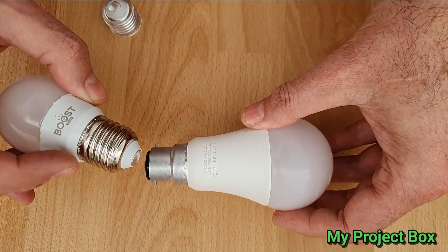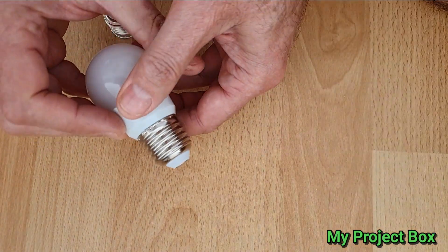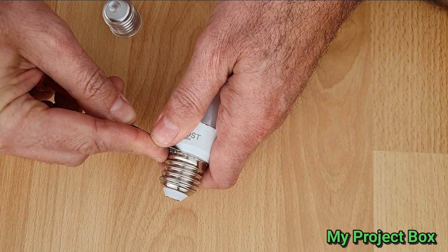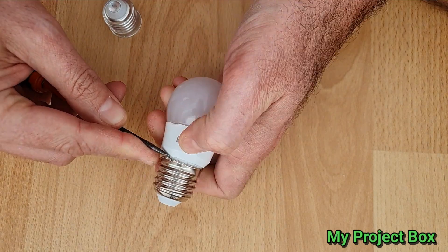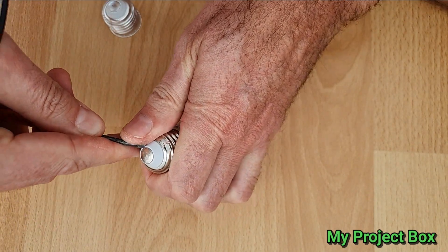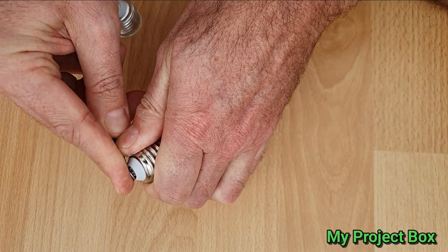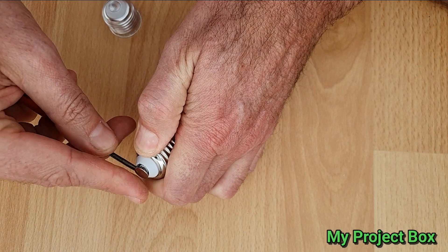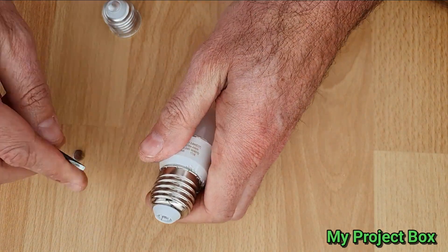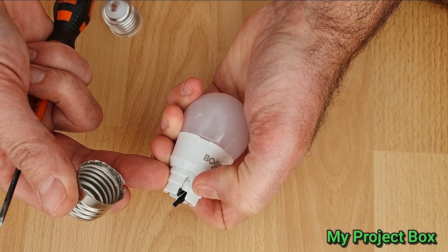It's relatively simple. You can just pry it off from one of these bulbs. You just have to wedge it in to the side here and with a bit of force work your way around, and it should come off. Also, this little pip here at the end levers out. It just wedges in the electrical connection over there. Then this comes off, and that just traps one wire in there.